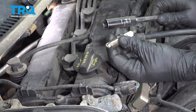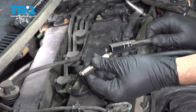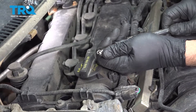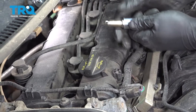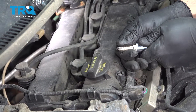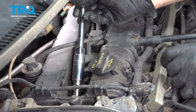I'm going to go ahead and take your spark plug. Now this one here does not require any type of gapping or anything like that. This is a platinum tip spark plug that replaces the factory part. Slide this into your spark plug socket and lower that down inside.